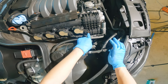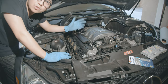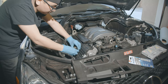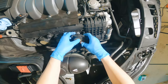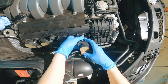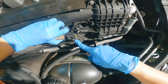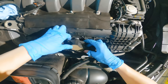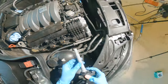There are tabs right here and you can take off the leads to the coil pack — it's totally up to you, but I'm going to unplug these because it just makes it easier. When you pull out your coil pack, just be careful. Don't just yank it out, be slow with it. The clip on this one is broken — interesting. I mean, it's an old car, so I can't really fault it too much.